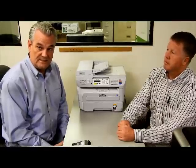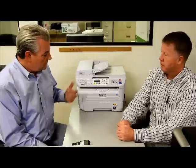There are times when you put a toner cartridge in — not very often, but with a generic or compatible cartridge or drum — and your printer won't recognize it. The way to resolve that is simple: just turn the machine off, take the power cord, unplug it, and leave your machine unplugged for about 20 minutes. Plug it back in, turn it on, the machine will recycle through, recognize the cartridge, and you're set to print.